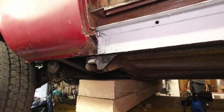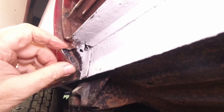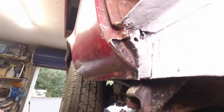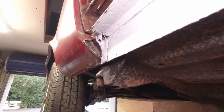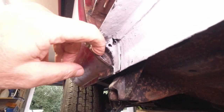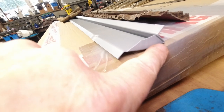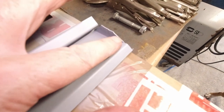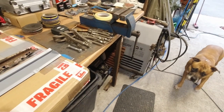Next is this side, okay, and I think I might just take this out of it as well, because that looks crusty in there now. I don't know if you can see it or not, but we'll go and do that. We'll take that one off as well, I think, and offer it up. Offering the new and just stay with the new altogether, because that's weak in there as well. Same deal, really. It's gone to nothing inside. The actual lip is what I mean. This piece, guys. The lip. So what we're looking at there is in there. And that's completely gone. Well, it's gone down again to less than half a mil, quarter of a millimeter.